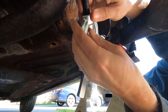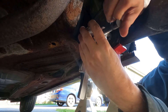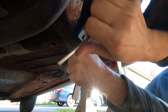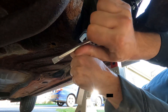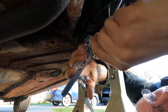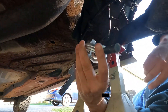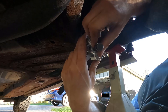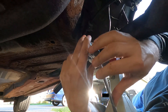I'll bring in the flaring tool and line up the cone with the depression on the top of the anvil, then tighten this up by hand first. As I tighten this up I'm trying to keep an eye on it and make sure that the flare actually happens and that it's not just pushing the tool down the line. Once that's fully seated, I can loosen this back up and take it off — the end of that line is mushroomed over nicely. Now I'll bring in the flaring tool without the anvil and do the second part of the flare, getting the cone centered in the end of the line and tightening slowly while keeping an eye on it.